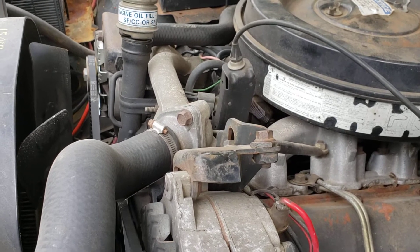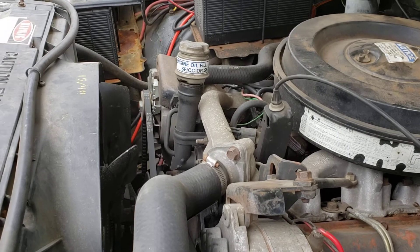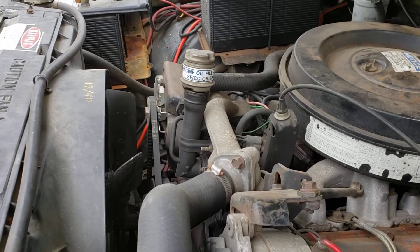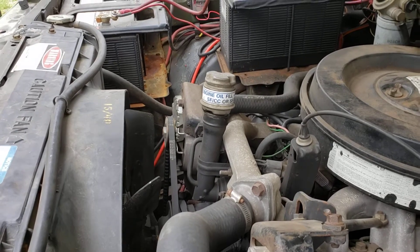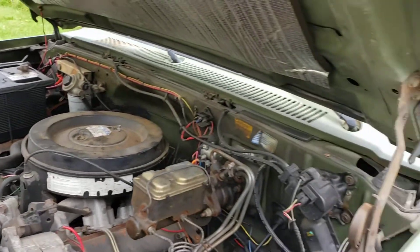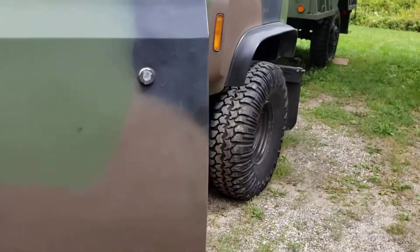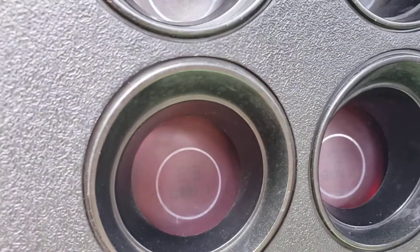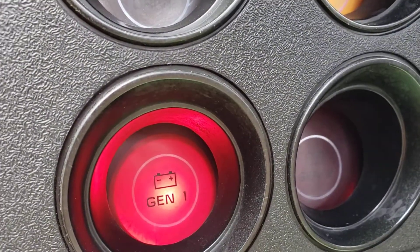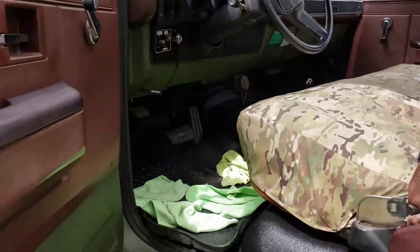He told me how to check the alternators and I had them checked by the auto parts store, and supposedly they were good but they did the wrong procedure to check them. There are a number of ways to do it. The first indication that you might have a problem is when you turn your key on you should see both gen lights go on. And you see right there only one is going on, right?